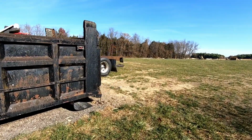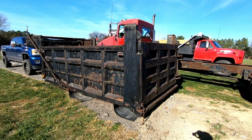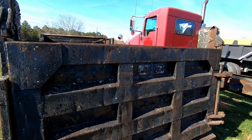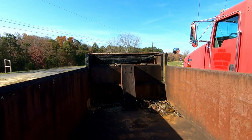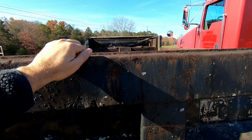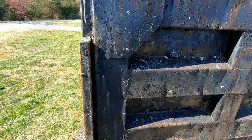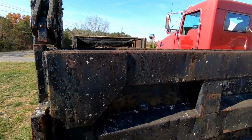on the ground right there behind that truck. So it needs a little bit of work, but it's fairly good. It's more of paint work than anything. Probably that wall, we're probably going to replace that wall. You can see a pinhole at the bottom there. And then this back wall and this tailgate is also not that great. We'll probably cut it out, replace it. They were using it as a barn door, so they cut this. So we're going to have to remake those.